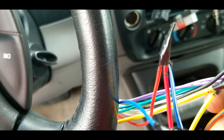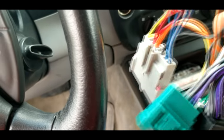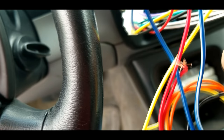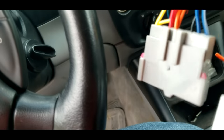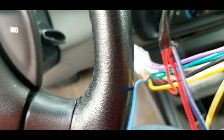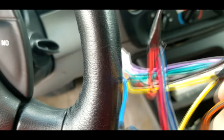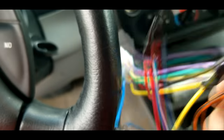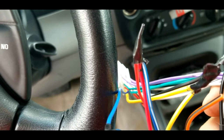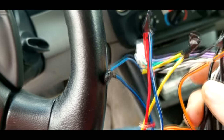All you've got to do is connect the blue/white amplifier wire to the red wire. I just took all three of them together since there are so many harnesses. That's the fix, guys — it's really, really simple. I know I prolonged this video longer than needed, but I wanted to explain it the best I could because I've seen so many things on the internet that are not helpful. I spent 24 hours trying to figure this out and I actually found something that showed me this, but it was a long drawn-out video.